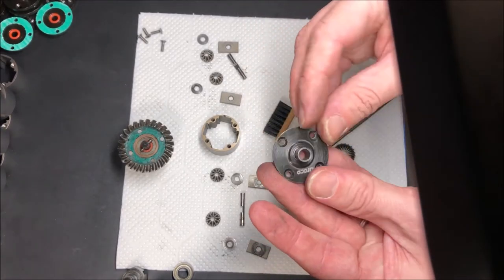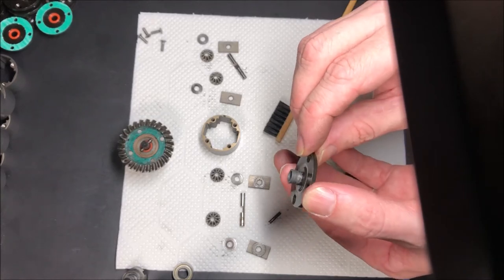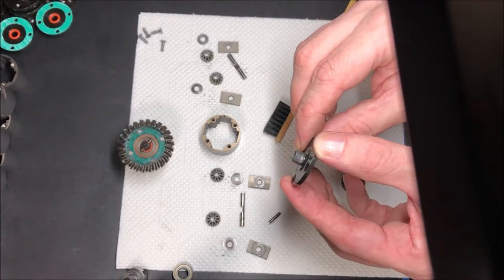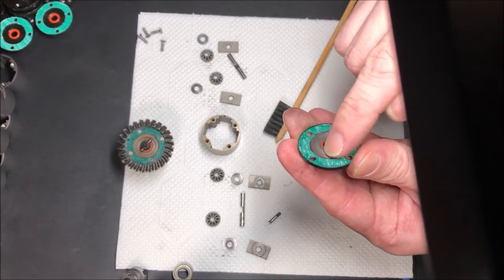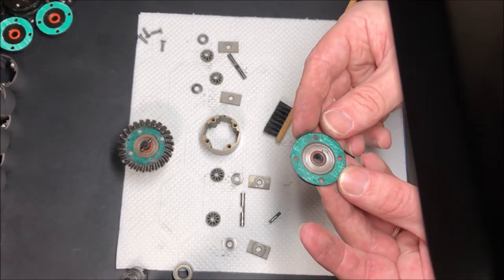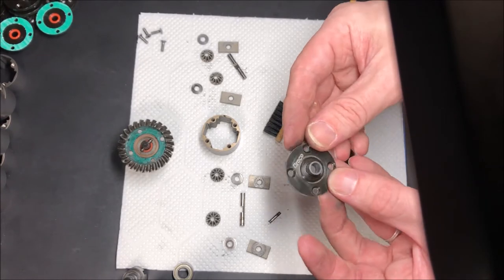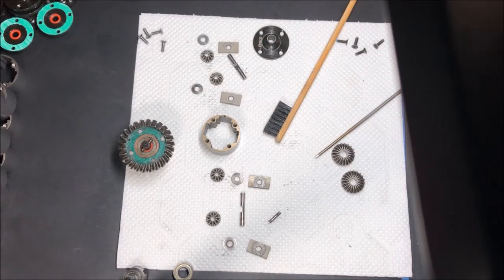Here is the cap. You can see there's some wear from the bearing moving — may need to increase the tolerances just a little. There's no leaking; the case seals up quite nicely. That's the rear diff done. I'll be doing the front diff next.